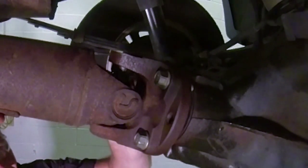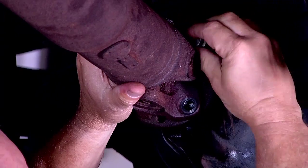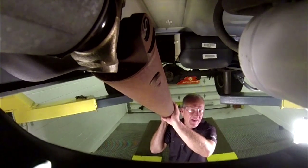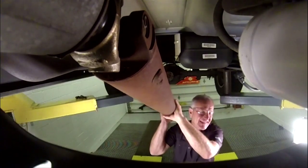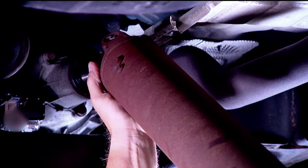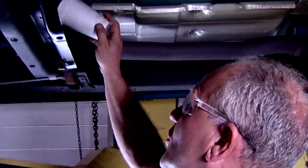I've already taken the fasteners out to make this quicker, otherwise they would have Loctite and this procedure may take a while. The last fastener's coming out. Drive shaft is off the flange. I've got the flange off the rear pinion. Now I'm checking to see if there's any problem with the splines at the end of the transmission. The slip is about to come out — there may be an oil leak so I'm prepared with a cup. Shaft is down and I'll push a cup over to slow the oil leak down.